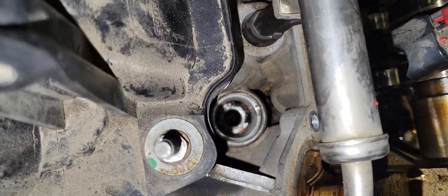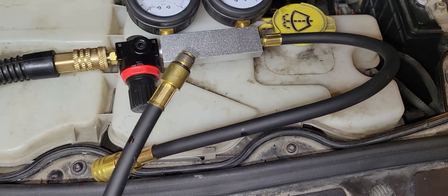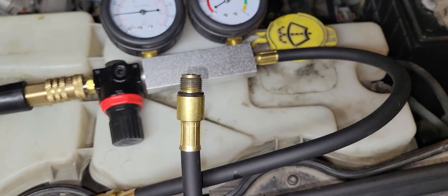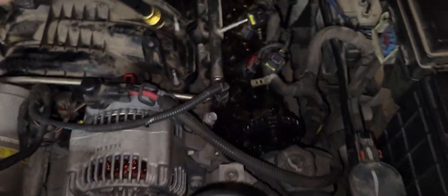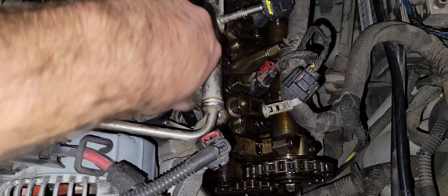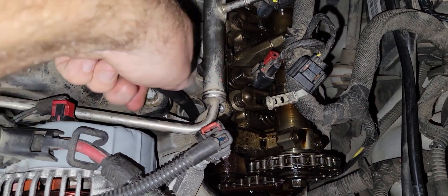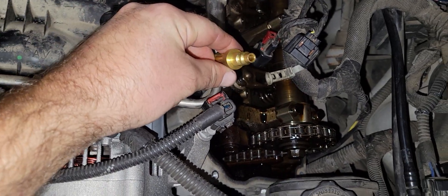And if you look down there, you can see the top of the piston's got a lot of carbon on it. So this leak down tester — it's just got a threaded end with different size fittings that come with it for different vehicles. And we'll just screw it in to the cylinder hole until it's good and snug right there.